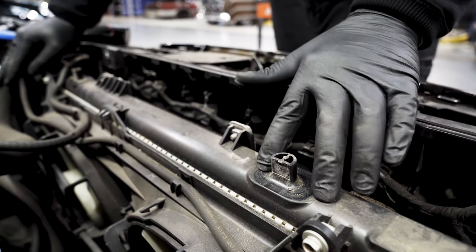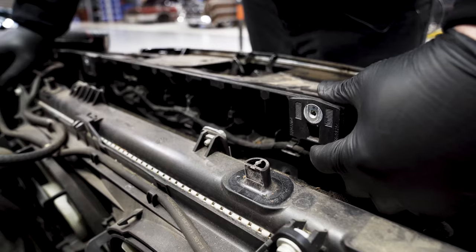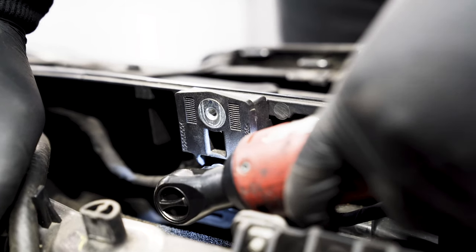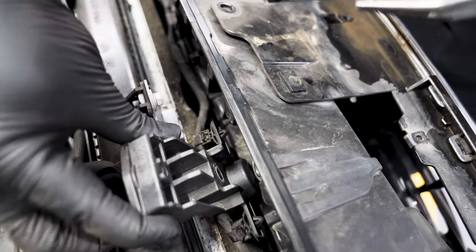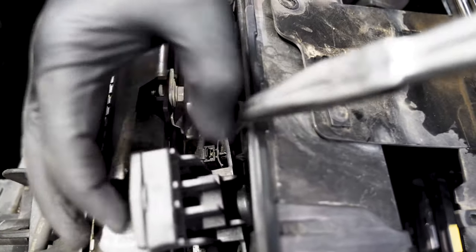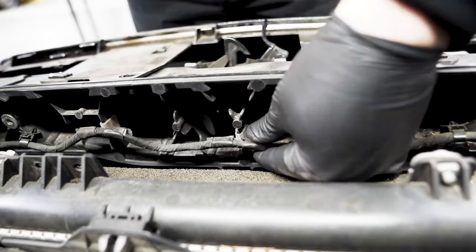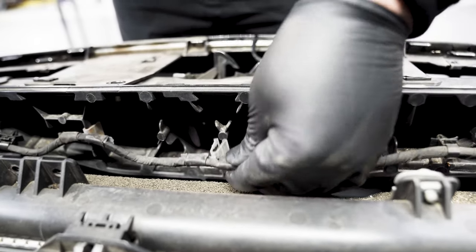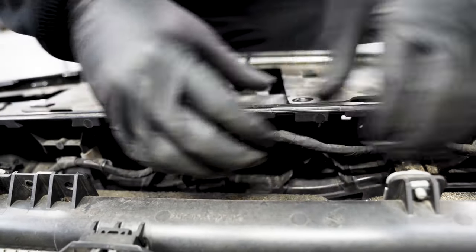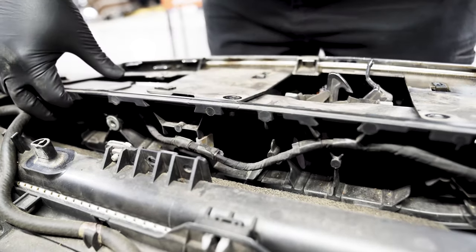Now we need to get to the bolt underneath the radiator support bracket, which is a 10 mil bolt. Once removed, retain these bolts as you'll use them later. This support bracket also has the wiring loom connected to it, so you'll need to use pliers to unclip the loom retainers so you can remove it. Pull the retaining clip out from under the bracket and move it up out of the way, and you can run the wiring loom up underneath the brackets when fitting these for the radiator.